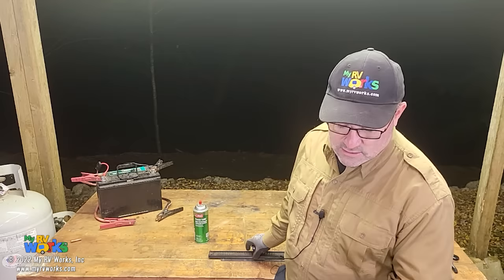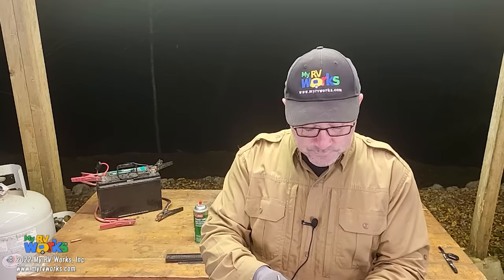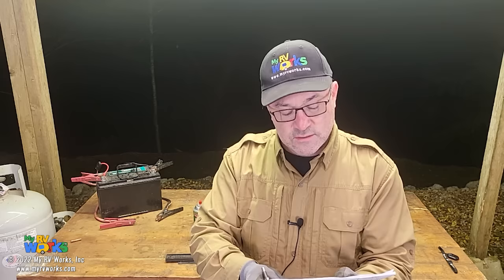It involves a Schwintek slide room. He's got a Jayco with a Schwintek, and when he hits the button, both motors will start to go out about 2 inches, then his Schwintek will stop. He's still able to get it in and out, but it always goes 2 inches at a time. His voltage is good on both motors, he states, and the controller does not seem to have any kind of error code or fault code.